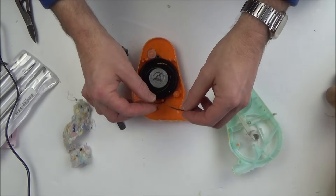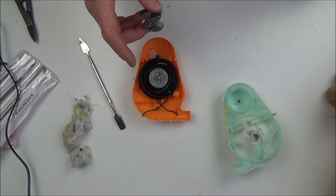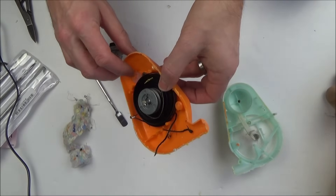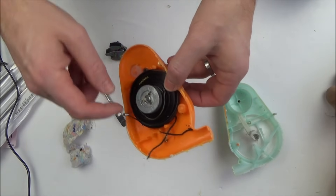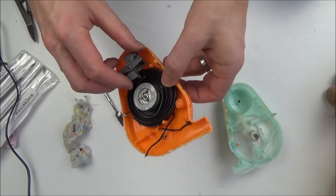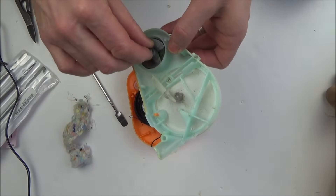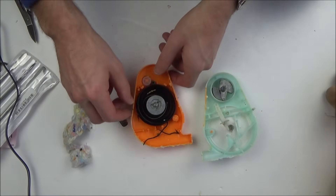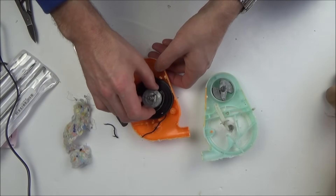What we have here is an old rubber band — a belt! So this is exactly the same as the Walkmans that I was fixing. The reason it's going too fast — remember when I pulled it out and it goes in really fast — is because this belt should go round between the record and this pulley here, and it must be this thing here that slows it down, because this has kind of felt pads on it. It must be this movement here that stops it from spinning too fast. So it looks like we need to put a new belt on it, which might not necessarily be a massive problem because I do have some of them.